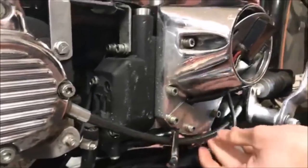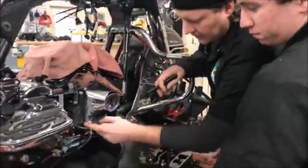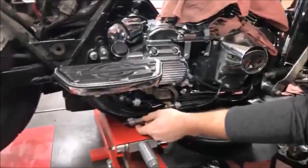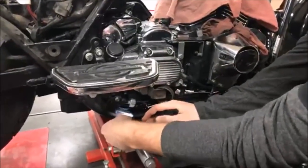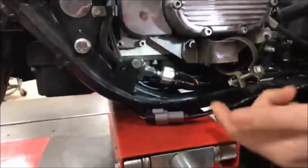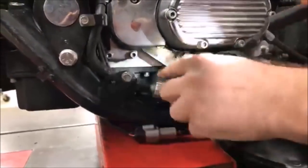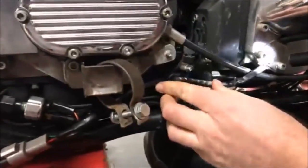Let's focus on that clutch cable. We're tearing this motor down, and first off the bike wouldn't run — we had to rebuild the connector because it was broken. The secure clip had broken off and the thing had vibrated back to a no-spark condition. This is actually supposed to be tucked in here; we just have it here to prove the bike would run while we disassemble it.